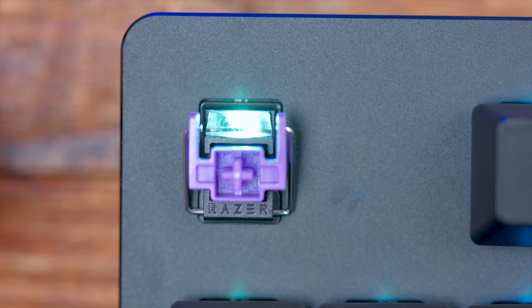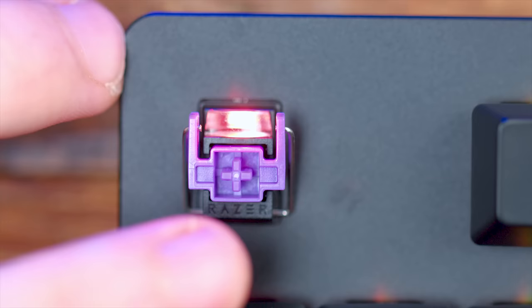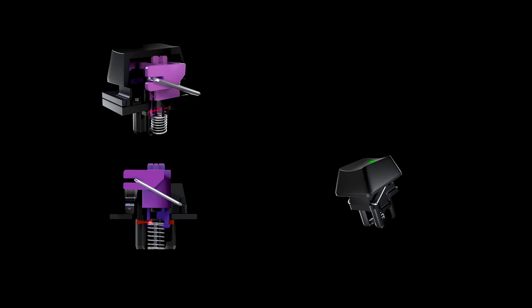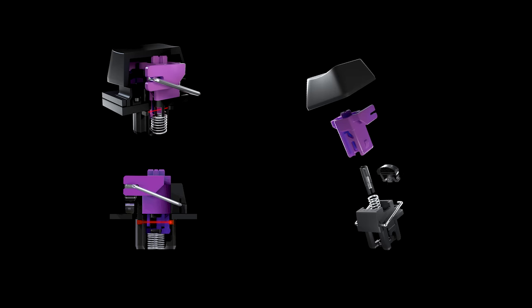switches. These actuate by breaking a little optical light beam inside the board, which immediately sends a signal to your PC. It is designed so when you click the switch down, it actuates, registers, and resets all at the same time. In the way the actual switch is constructed inside, the mechanical aspect and the optical beam are 2 separate parts, so you're still getting that satisfying tactile click.